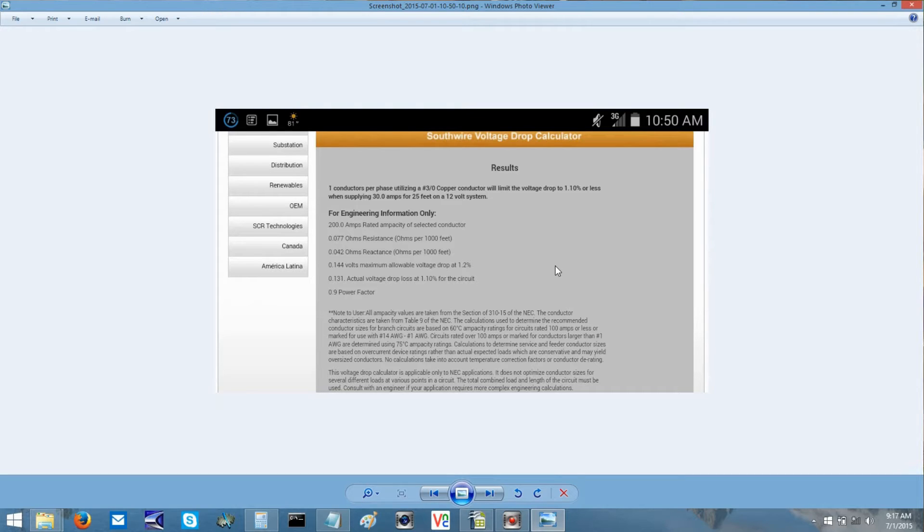So that's three-aught. Now a lot of you are going to say, oh that's 30 amps, I only need to run a number 10 wire — which is true if you were running 110 volt or 240 volt wire to a device out there, because the voltage drop is calculated at around 1.2% to 2%. But on a lower voltage at 12 volts, to keep that voltage drop around 1% to 2%, you're going to have to run a three-aught wire to go that 25 feet. If you're using any wire smaller than that, you're literally starving that device for amperage, and your wattage will even go down.